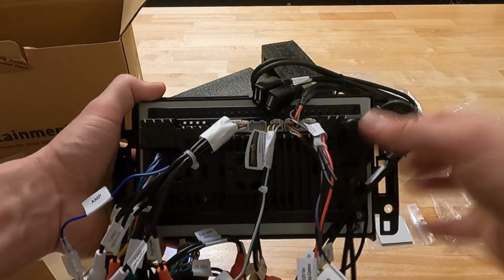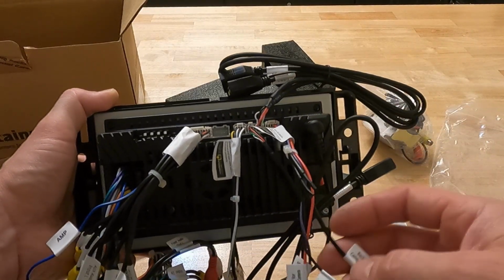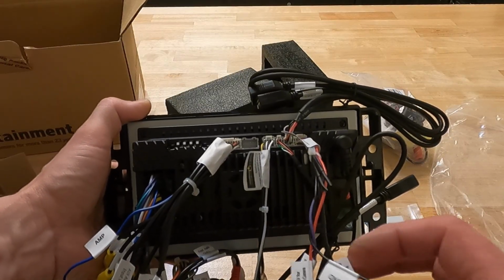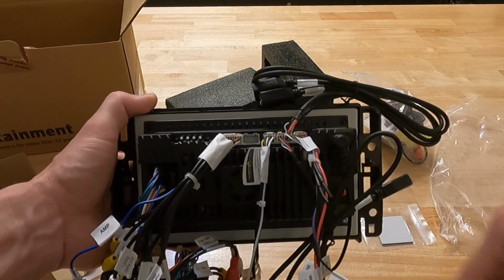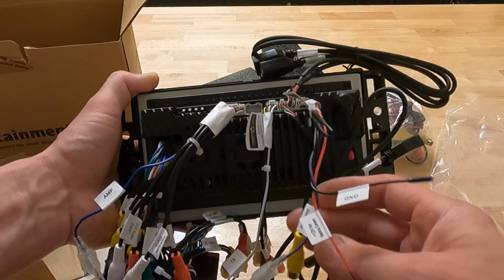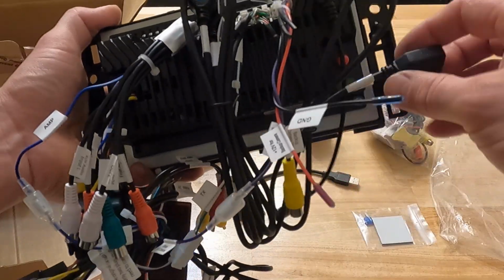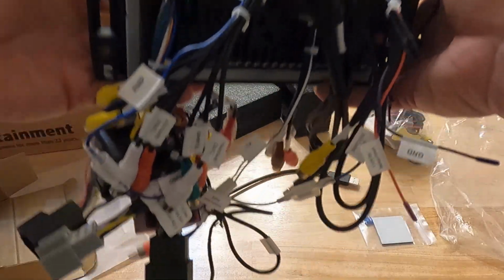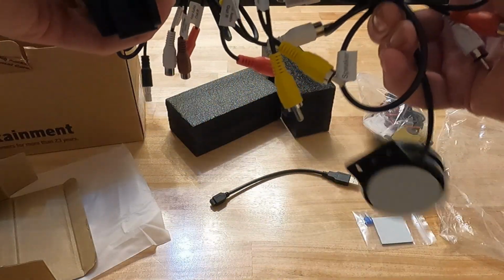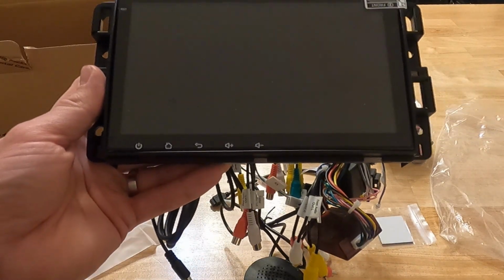Okay, I just wanted to clarify one thing before we go to the car. I put the backup camera plug in here and this port is not used. It actually goes here. And then on here, there's the 12 volt to the camera and a ground, but on the wire, there's a 12 volt and a ground in the back and just a 12 volt on the front, so I'm gonna wire it up the way the instructions say, and we'll leave this ground alone. So I'll run the wire to here and hook the red to that, and then everything else is going to be plug and play. So yeah, we're ready to go out to the car. Don't have any amps running in the car or anything like that, so this will be real easy to install, and we will have CarPlay and Android Auto before you know it.